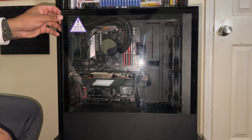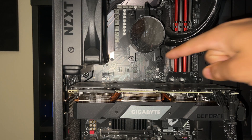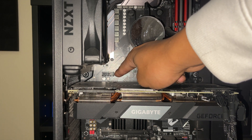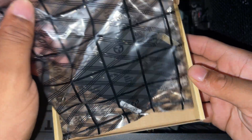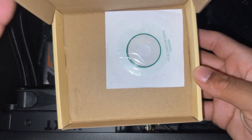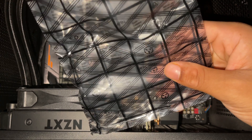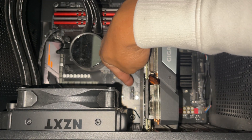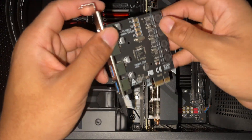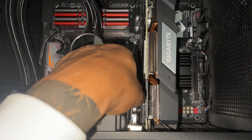This is the actual piece that we need. It's pretty simple. We're just going to screw the screw off here so we can pop the front off, place the glass down on the ground. And then you can see here, my finger is pointing — that's exactly where the port is that we want to plug it in. Opening up the USB box, this is what comes with it: the USB itself, mounting screws — which are nice that they have black and silver depending on which type of PC you got — and it comes with a disc that you don't really need. We take the extra USB chip out of the bag and then plug it in. As you can see, there's a short side and a long side. We just plug the long side where it needs to be — there's only one way it can go in, so it's really hard to mess that up. We're just going to place the chip in right here so we can see which case cover we need to take off.